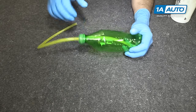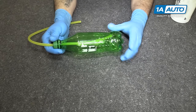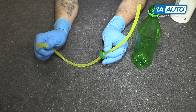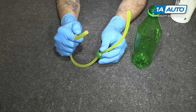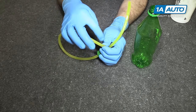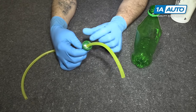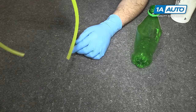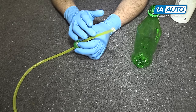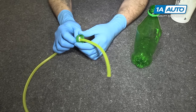All you do is take an old soda bottle — you can use any kind of plastic bottle, but just about this size is what you want. I drilled two holes in the cap. This is 3/16 fuel line, and that's what you want to use because it sits pretty tight on top of the bleeder screw, so you don't need anything to tension it on to make sure that no air or moisture gets in there while you're bleeding. Drill a hole big enough to fit the fuel line through, then throw a zip tie on there so you can hang it from the back of the vehicle and not worry about it falling. If something happens, the hose will stay down there submerged in the fluid — we don't have to worry about it moving around or pulling out on us.